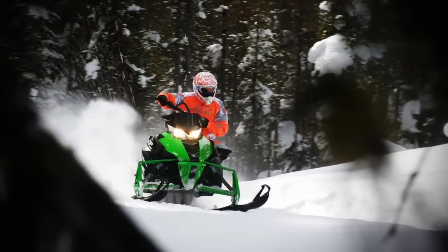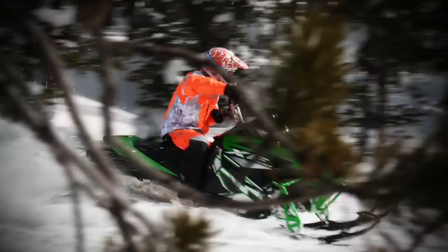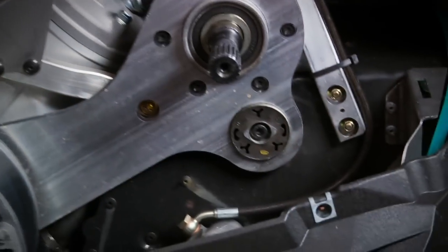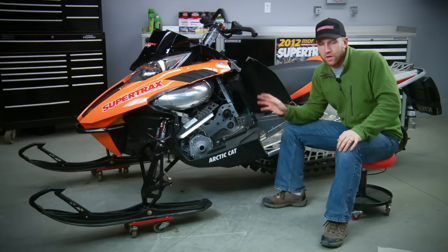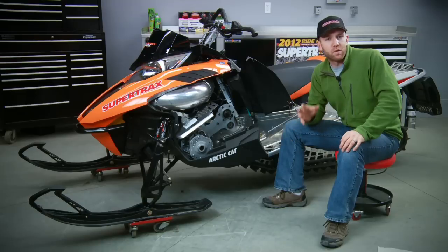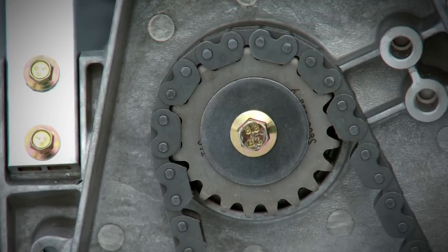While the fixed link between the motor and jackshaft is pretty easy to understand and visualize, it's the chain case side of the motor that most will overlook. But remember, if the clutches are moving in perfect harmony, there must be movement on the other end of the jackshaft. The engineers at Arctic Cat no doubt spent some long nights working on this one and making it perfect, but they found a way to incorporate a moving jackshaft into a fixed chain case. They do this through the use of a special bearing on the chain case end.